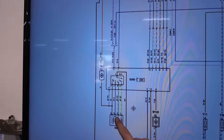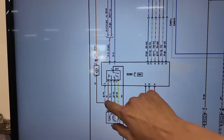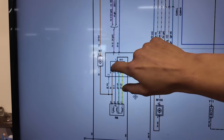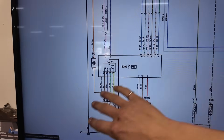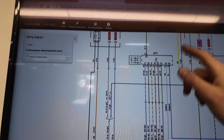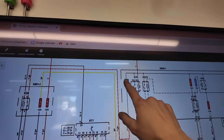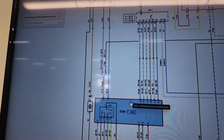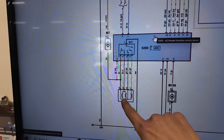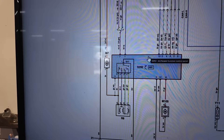I'm just going to the diagram quickly to show you what we're going to test. The diagram shows our resistor — what we just wired up — and this is the motor. We've got our control wire going in from the resistor, so that's just the switch changing the output to the motor. This is our main power in. We're going to make sure we've got a live there, which will confirm the fuse and relay are good, and then we'll do a little check to make sure wiring it up wrong hasn't destroyed the diode in the resistor.